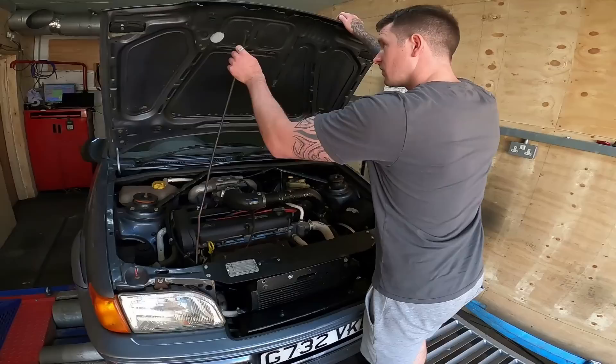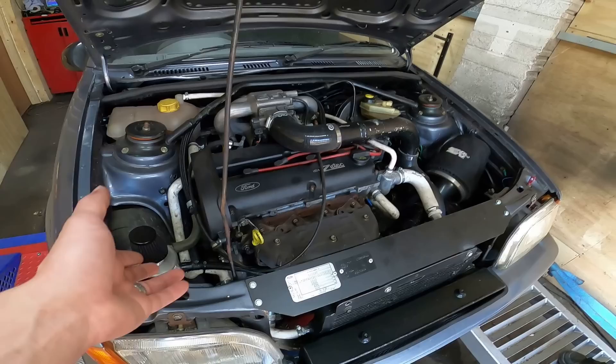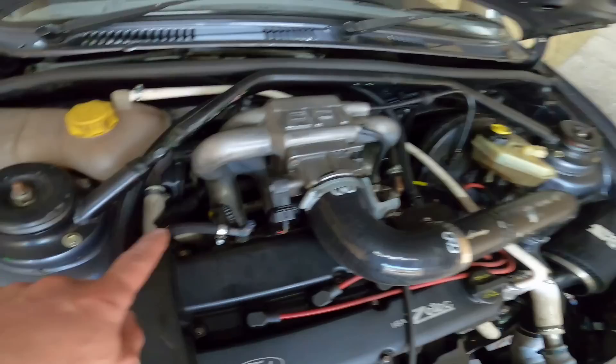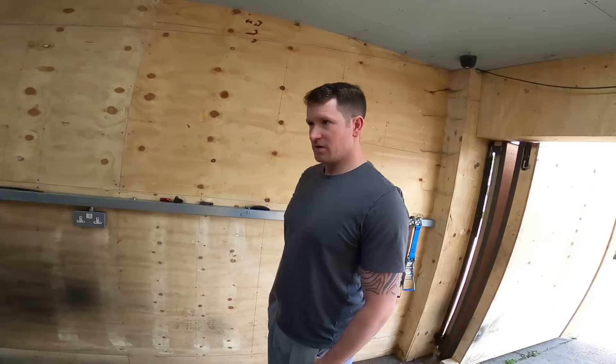He's got an EVO manifold under the bonnet. This is the old engine out of my red race car - it was getting a bit tired so I donated it to Jamie, detuned it a little bit, and it's been absolutely mint. The spec is a fully forged bottom end with pistons, rods, ARP main cap bolts, King Racing big end and mains, M12 stud and nut conversion, ported and polished head with Cat Cams, Cat Cam valve springs, and a solid timing belt tensioner rather than the sprung one.